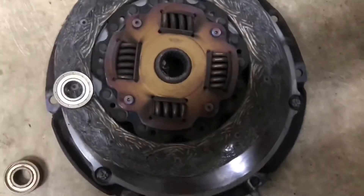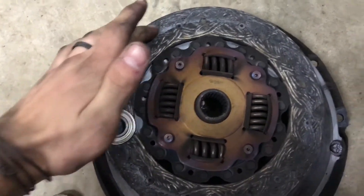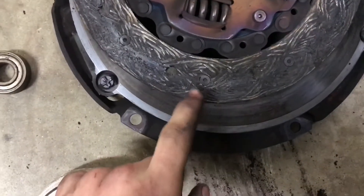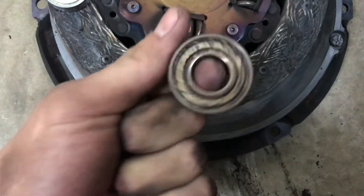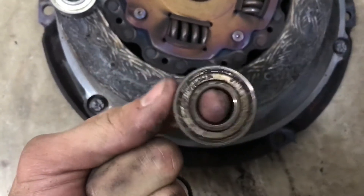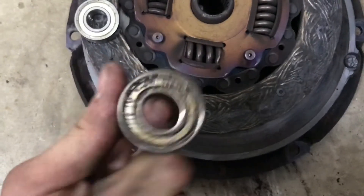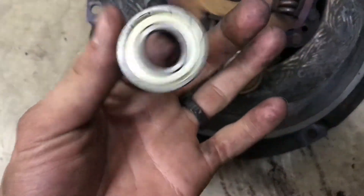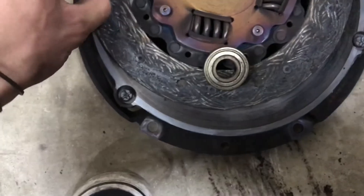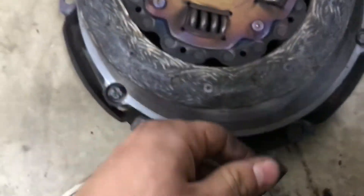After further review, the clutch itself — parts of it don't look bad up here and around here, but this line goes all the way around and on the outsides it's really worn. Also, my pilot bearing is very shot too. I don't know if you can hear it, but it's making a lot of noise. It doesn't feel smooth. The new one has no noise at all — smooth as butter. This one is all wobbly and sounds like shit.